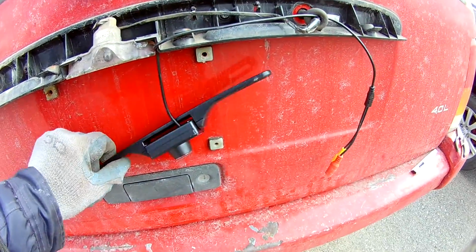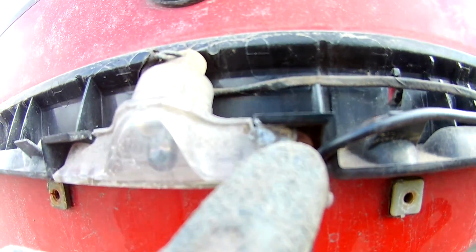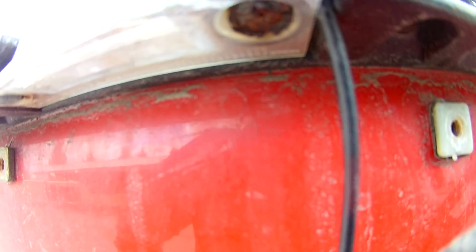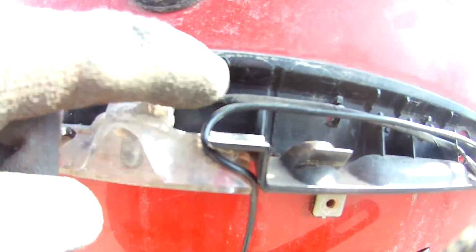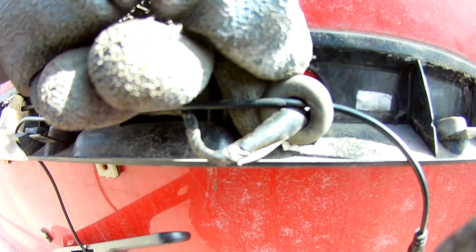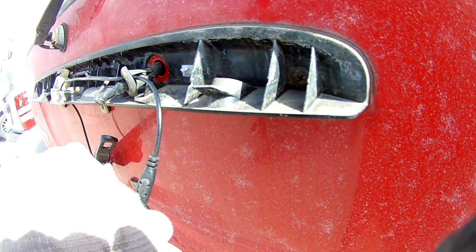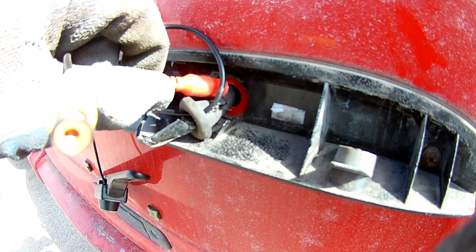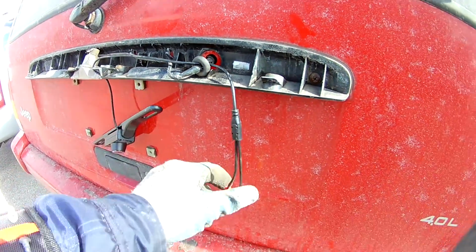Okay, so finally I was able to bring my camera wire through this gap. You can see through this gap, and you can bend it over here and take it from here. So I don't need to drill a hole for that. There is enough gap between your light plate and it comes through here. And here you can see I just split cut over here, but I didn't cut the complete rubber. You can see it still has that shape, but I just cut it inside and took this out. So now I need to successfully push this inside this hole, because the hole size looks like it can go inside, but you can see this wire, tapes and stuff, so it's a challenge to push it all the way there. So I'm going to do that, and these two will be inside then.